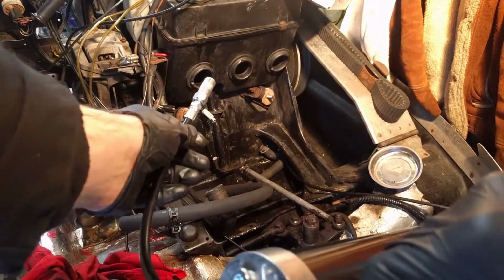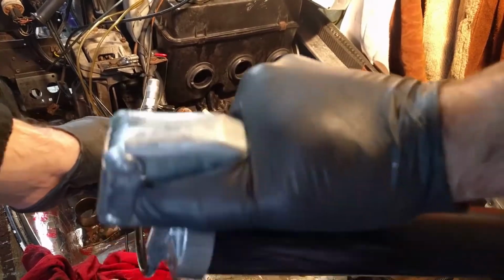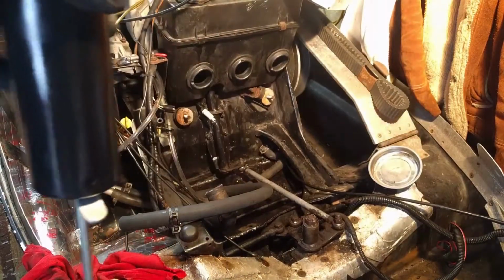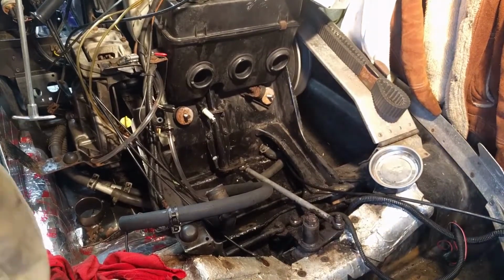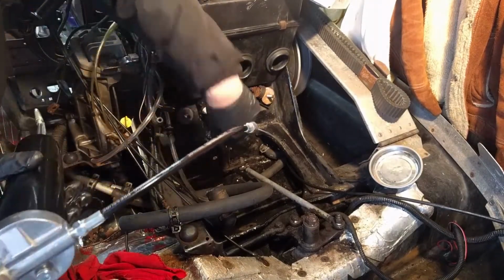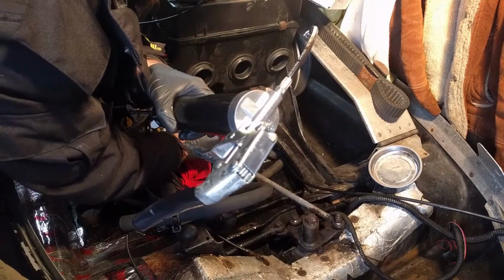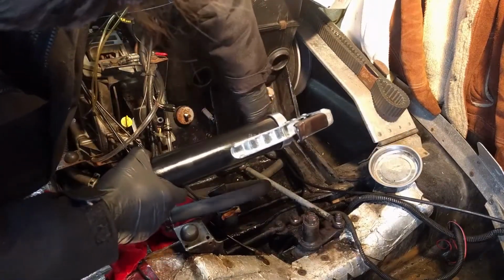So pump, pump, pump. Oh, there we go. Okay, things squirted off like a little fountain. All right. So first, zerk fitting. It's located right here. Wouldn't hurt to take a rag and just kind of wipe off some of the goo before you add new grease, so you're not jamming dirt into the... Pop it on the zerk. This is for your steering.